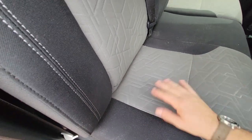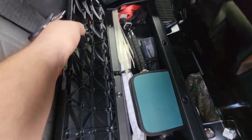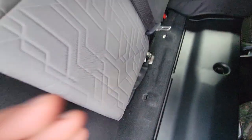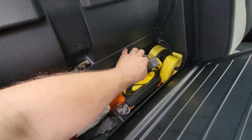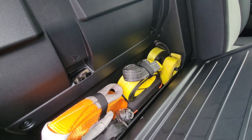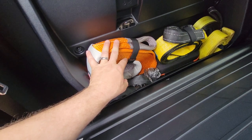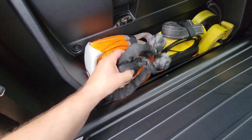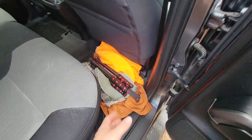On the passenger side rear, same storage setup — I've got a storage compartment under there with the jack, plus all kinds of gear: tire repair kit, mini tripod, zip ties. Behind that compartment I keep my expensive recovery gear: a TacLife jump charger, two tree savers I use as a bridle for cross tow points, and an ARB dedicated snatch recovery strap — the real stretchy kind, about $65. I also keep a couple of soft shackles back there.